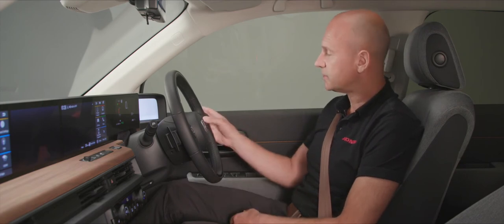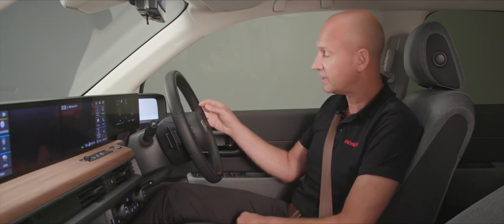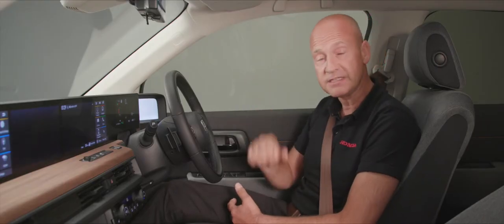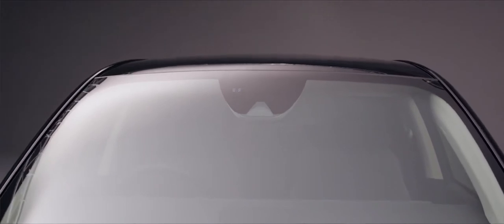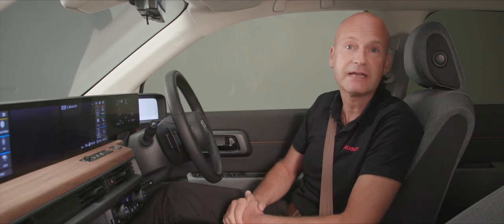There are user-selectable features on Honda Sensing. For intelligent adaptive cruise control, press the button next to cancel, then scroll using the LIM button. You have three functions: a speed limiter, where you set the limit with the set button and adjust plus or minus; an intelligent speed limiter, which reads speed signs from the camera and limits your speed accordingly — for example, 60 mph; and intelligent adaptive cruise control, the most advanced, where you set your desired speed and the system maintains it, accelerating up to that speed as traffic clears.